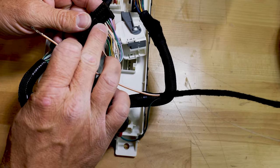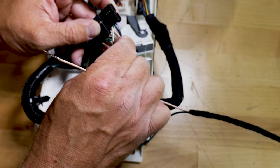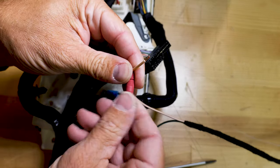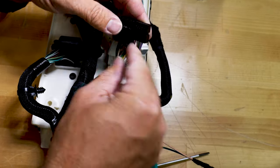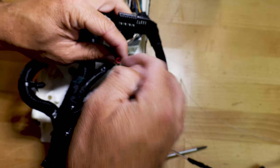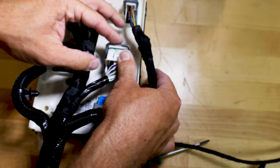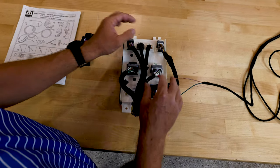As mentioned before, if the pin was vacant we already have the proper terminal on it and we can just slide it right in and it locks into place. But since it already has a wire there, we're gonna go ahead and cut off our terminal and install a posi-tap using the exact same procedure. Both wires are now connected, everything's nice and tight, both connectors are clipped in — we're done with the wiring procedure.